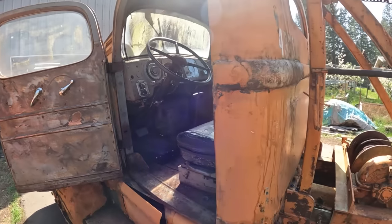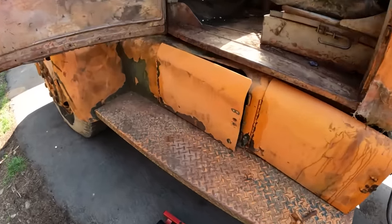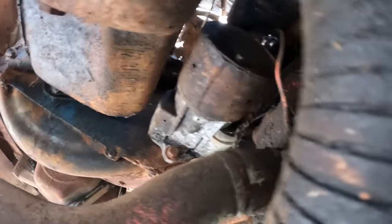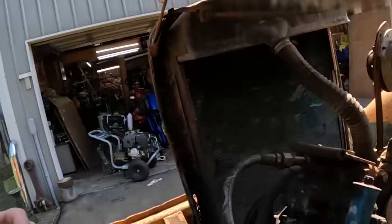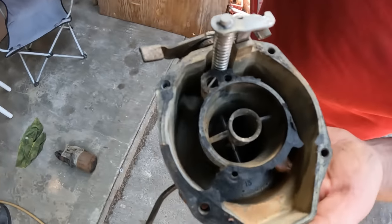We're getting power to the coil up there, but we can't get anything to turn with the starter. I'm going to climb underneath the truck to see if both wires are connected to the starter. We tapped into the line and we are getting power - the big cable is connected up in there. Seemingly it should be getting power to the starter, so we think the starter solenoid is probably bad. Since we're getting nothing from the starter and it is getting power, we're just going to assume the starter's bad and pull it off. While I do that, my dad is going to pull off the carburetor and get it cleaned up.